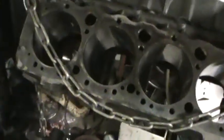Well, it's the next day. I didn't finish up yesterday, but that block there might be used for something else now, so got to verify bore and that, and then we might have something good. This is the motor been turned down outside that was supposed to be good, ready to run, and is stuck. I gotta get the flywheel off the rear. It's a one-piece rear seal. I gotta get the rear main seal off, get it on the engine stand, and dish out some of the evapo rust and put in that cylinder and see if we can get her broke loose.